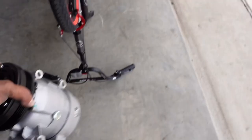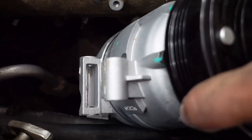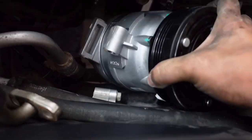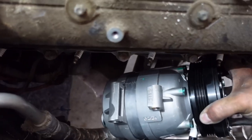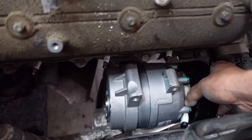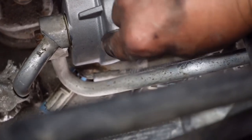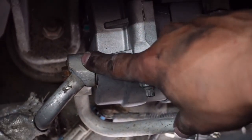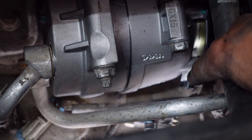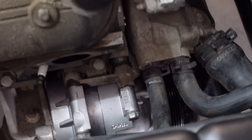Let's go put this back in the same way we got it out. It's basically right in place - the old one was a pain in the butt but the new one just slid in like nothing. Got the bottom bolt tightened up and the top bolt tightened up. I've gone ahead and replaced the O-rings on the back. Now we've got to reconnect the AC clutch connector, throw on the new belt, and take this thing to get evacuated - put a vacuum on it, make sure there are no leaks, then charge it up and get some cold AC coming out of the vents.